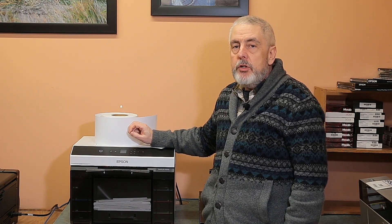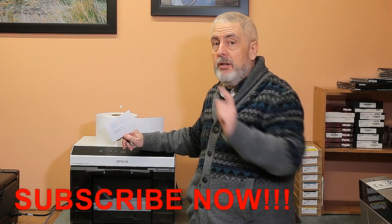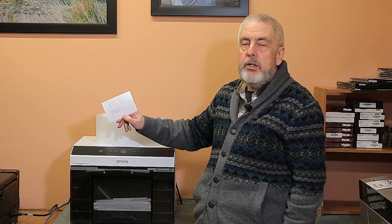But if you're not doing large volume constantly, this printer is not for you — don't waste your money. Compared to all my other printers, this one has the biggest problem with head clogs. If it's not used on a regular basis, it will get a head clog. My P800 — if I get a head clog every month, that's extreme; it's usually every two months. On this one, if you leave it sit for any length of time, it's going to get a head clog. So every day when I start it, I do a nozzle check on five-inch and six-inch paper to make sure it's okay. If you use it on a regular basis, it works great.